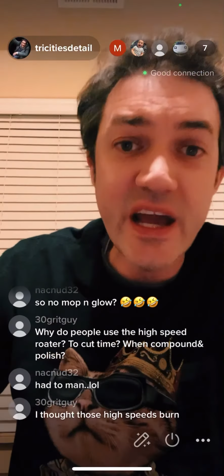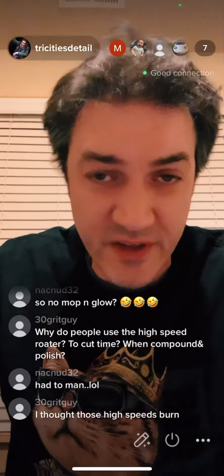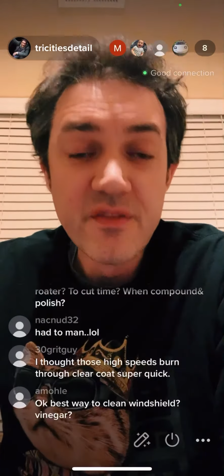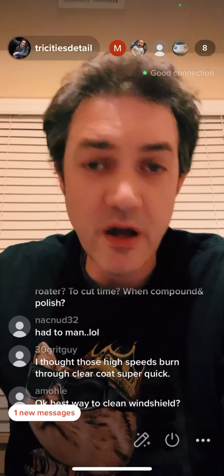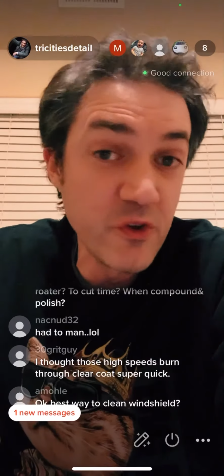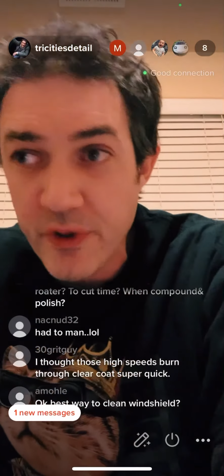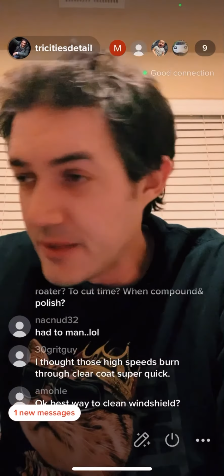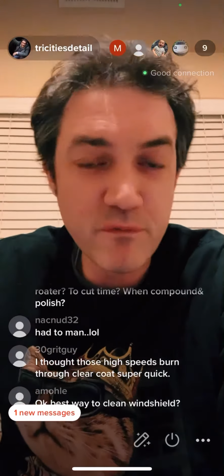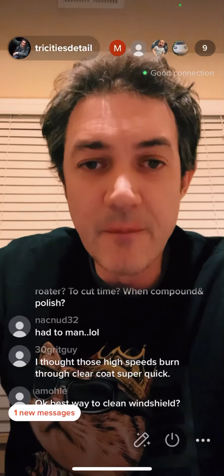But I only use a rotary anymore on boats, aircraft, and RVs. They absolutely do. A rotary can burn if not used properly. But if they're used properly, yeah, you can use them just fine. But yeah, you can burn through the paint. And if someone who's done rotary says they've never done it, they're lying. Anybody who's first starting rotary will burn. You'll burn the paint. It just happens.